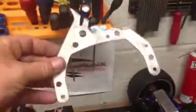Okay, so built the mount now. It's come off a stock sort of barger front chassis brace there. I've cut that off, bent it up, and made the new bracket. You can see there's the old one, it's cracked. I usually find the Victory Racing brackets tend to crack, the metal's not that great. This is not as thick, too bad alloy, so that's going to fit in. That'll go on them bolts there, and then fit on the exhaust. And it's giving it quite a good clearance. Should be enough there to get the shell in. Mission accomplished. Now on to the electrics.